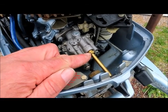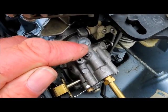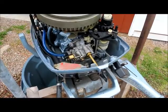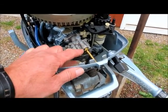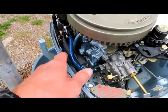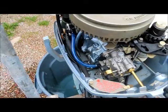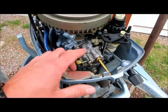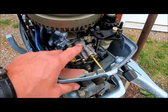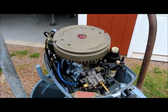Tighten the nut down pretty snug — that seals the whole system by pushing on a little sealing washer around that rod. Put your new welch plug in, put a little ding in the center to spread it out and seal it real good. Put your fuel line on and off you go. When you're out on the water, get the engine good and warmed up before making any lean/rich adjustments to the idle. I threw a new fuel line on here as well while I was at it. So don't take your carburetor out — just pop that plug out, clean those orifices, clean the tube going to the low-speed circuit, and you'll probably get an engine that starts and runs like a champ. Thanks for watching.